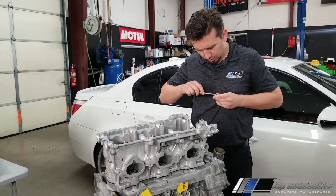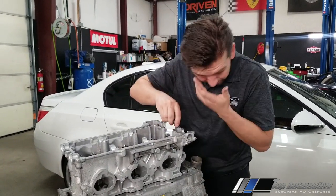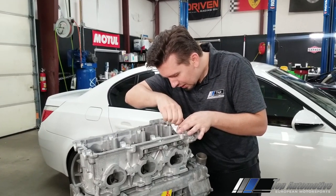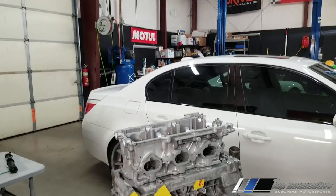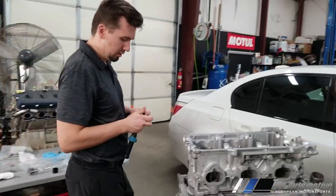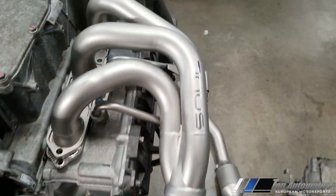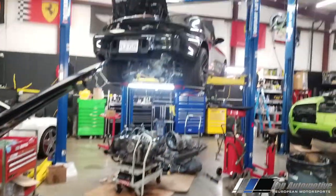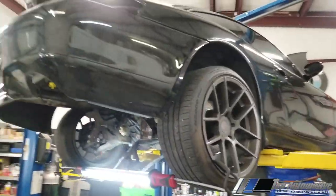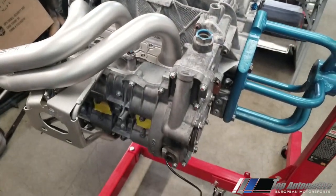That was a challenging engine — very challenging to do. Now we're torquing to 10 foot-pounds and then putting the head bolts in. The engine is finally assembled. We're putting headers on, high-flow cats, and solo headers. Here's the engine that's coming out of this 911 — the one with oil pressure problems. We've built a fresh engine for it and now we're just dressing it up and getting it ready to install back into this black 911.